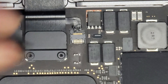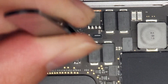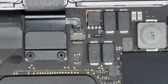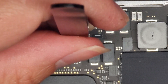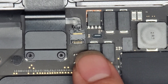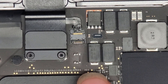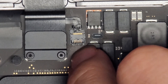The customer might have messed it up trying to fix it themselves, but let's see. So we're gonna try and get this on. Line it up. And as you can see, we were able to get that on. You do want to be careful because those are metal pins — you don't want to touch them with the metal tweezers and fry something. So once we get that on, just slide your finger over. Don't try and push it. You want to just slide your finger over to latch it down — just like this. And there you go, you can see it latched into place.